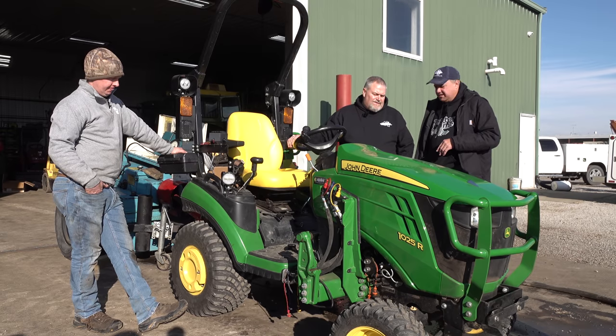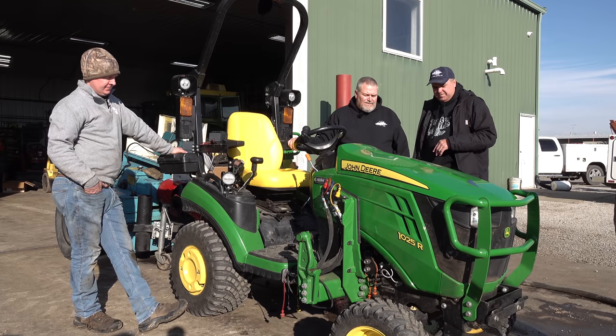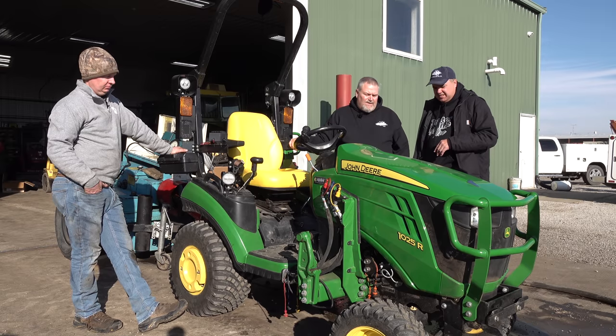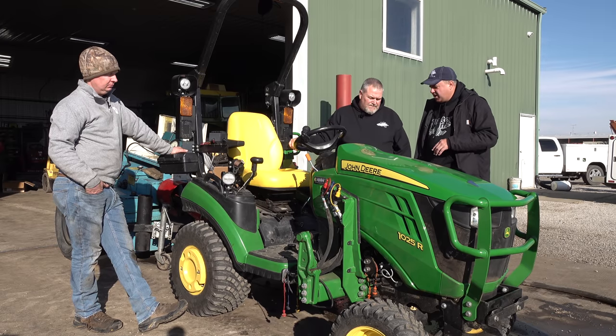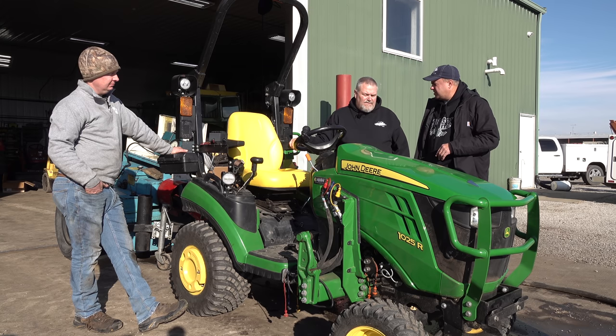Okay. And that was ranging in the 650, 525, just depends on where he's at. And pulling it down lower than rated on there is obviously going to drive the heat up on it too. Are you comfortable with those figures? That exhaust temperature? Yes, I am. Okay, what would you be looking for to be out of range? Oh, 1500 is going to melt.